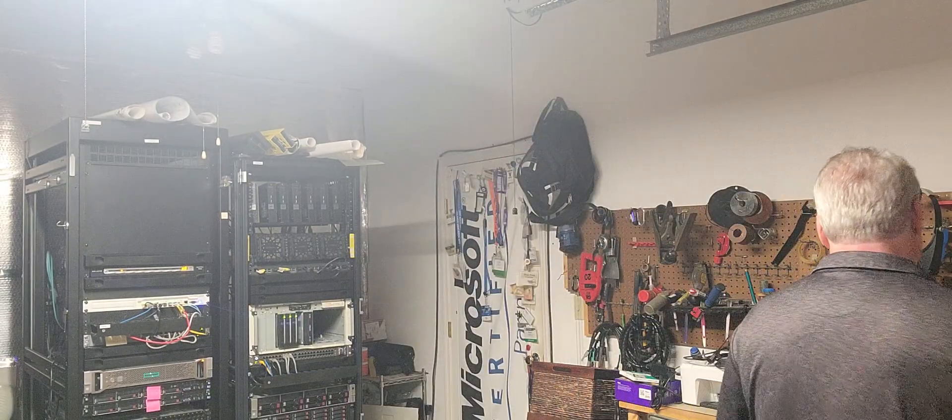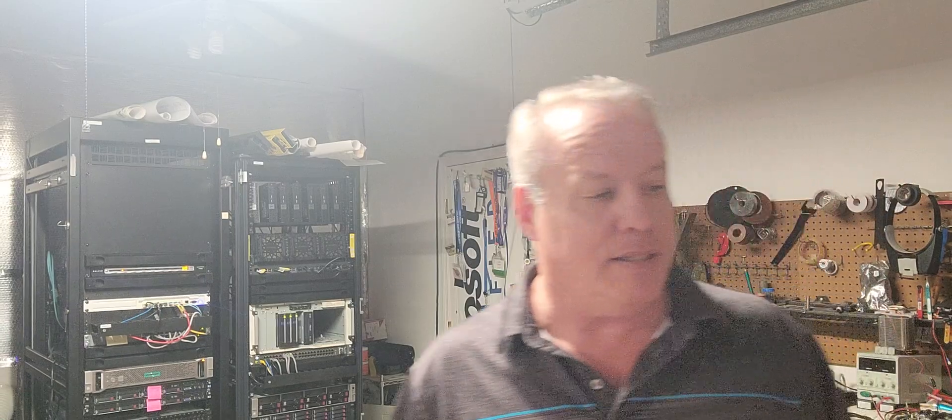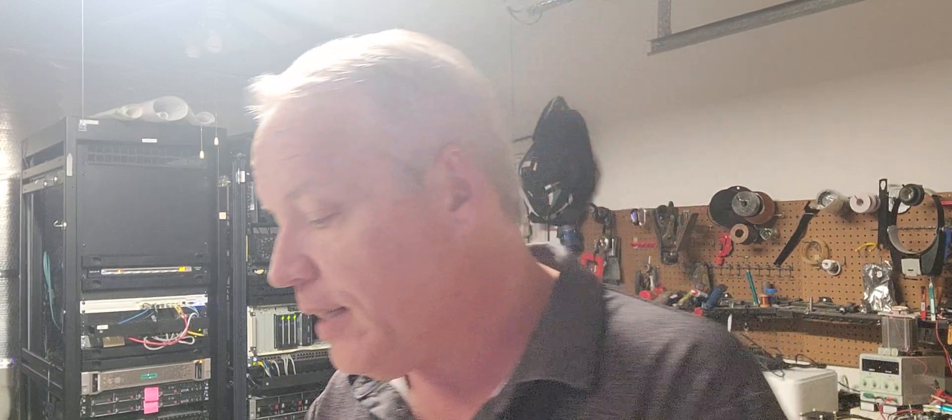With that being said, yes — and I've done videos on this too — you can get what's called a double-sided edge connector which will connect a SAS connection up to the SATA bridge cable connection and allow you to interface. But you still always need a controller, and that is the thing that keeps getting missed.